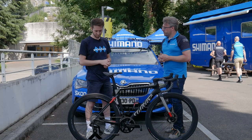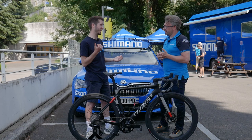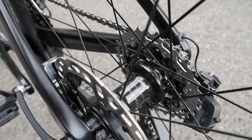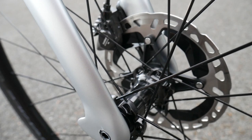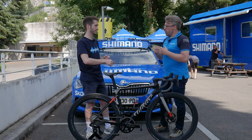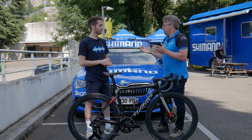For riders with existing wheel sets — will they be able to use them with this system? Shimano learned the hard way from the 10-to-11 speed incompatibility. Every HG-type hub body ready for 11 speed will fit a 12-speed cassette. However, if you buy new 12-speed wheels, you can't fit an 11-speed cassette at Dura-Ace level, as it has extra technology in the freehub body. Other wheel systems will be made compatible, but if you're buying 12-speed wheels you'll likely want the full groupset anyway.